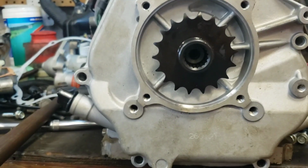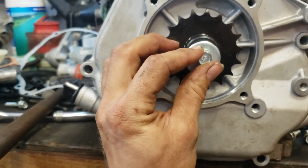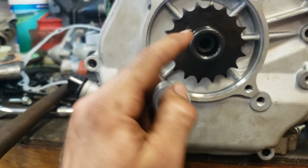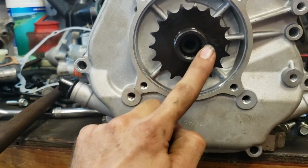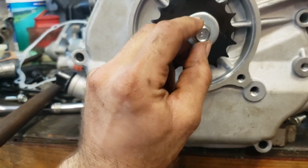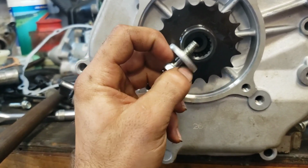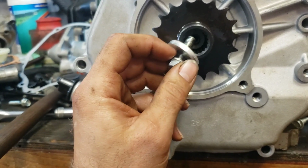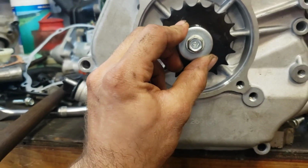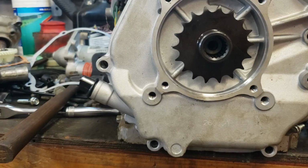And then I'm going to go another step further. We're going to have a longer bolt than this, which reaches down in there and has a big washer on it. Might even use the same washer. And I'm going to put a flat gasket here that seals the washer to here. And what that leaves is a tiny chance that between our bolt and washer it leaks. And I'm going to put a copper, sort of an oil pan drain plug washer around that. So everything will be very well sealed and no chance for leaking.